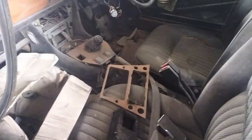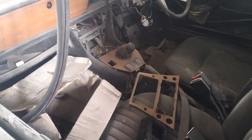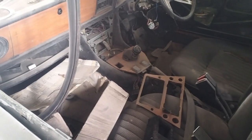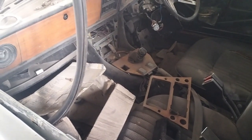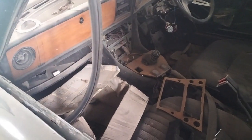The interior of the car is disconnected. You would normally have to remove the gear stick, as I mentioned earlier, and on that there are two wires for the overdrive, and there should be two wires coming up for the reversing light switch. You definitely need to remove the overdrive switch. I can't actually remember about the reversing light switch. I think that might be on the block connector that goes to the engine, so I'll have a look at that before it comes out.